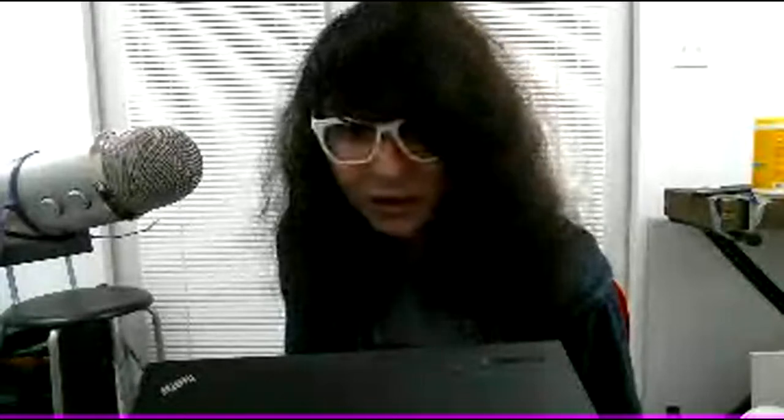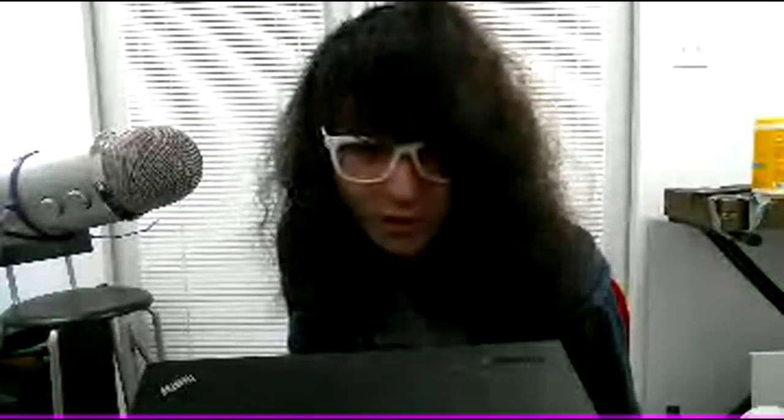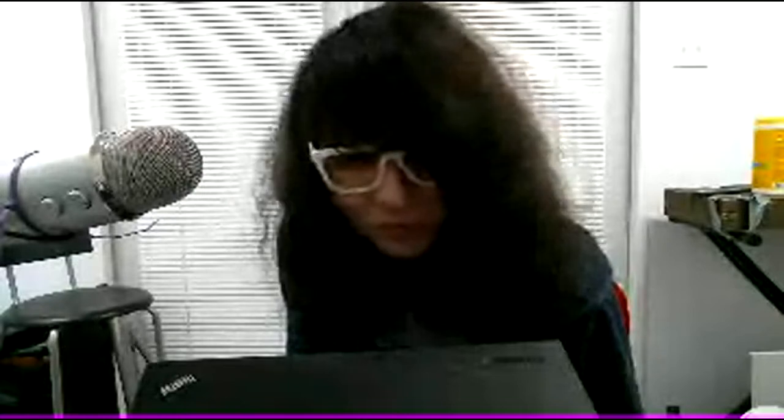Well, okay. So to answer your question on Coreboot and how it looks on the X220, it really depends on what BIOS payload you put on there. You can put on SeaBIOS, and that's essentially what I did the second time. The first time I put on a GRUB chain loader, which just was GRUB, but it would instantly load the next GRUB config file based off its location in Debian, which actually worked pretty well. But SeaBIOS does have more BIOS options, and you can add secondary payloads in SeaBIOS. You can have SeaBIOS chain load GRUB, for example.